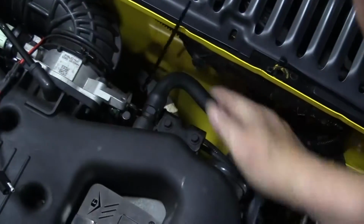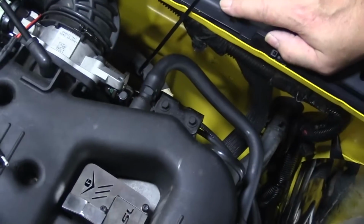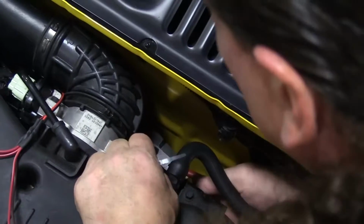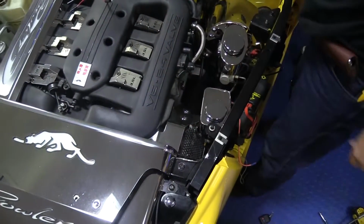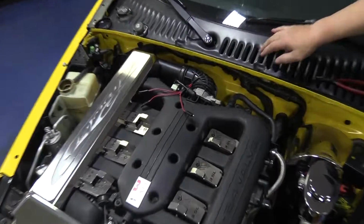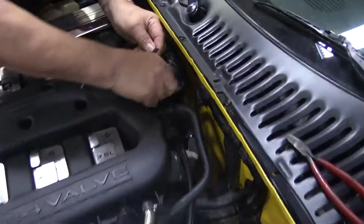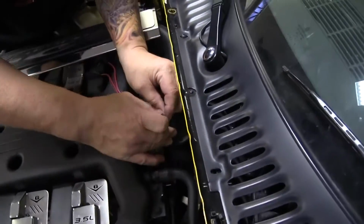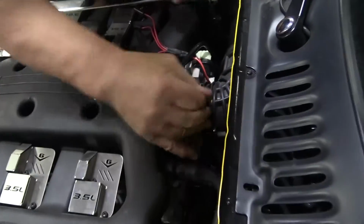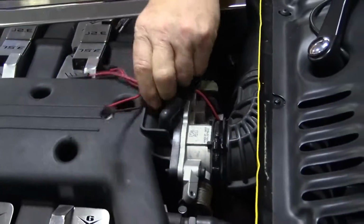And this one's also important because you have your throttle linkage here, and you've got a couple of moving parts. So you want to make sure that wire isn't going to get bound up anywhere. Take your dikes, cut off your excess zip. And last but not least, we're going to ask you to zip tie it right to your main tube. This will give you a safe and secure electrical connection for all the lighting we're doing. That's how you install that.